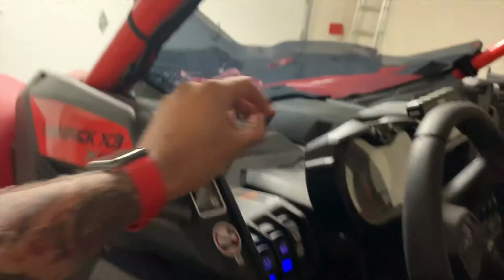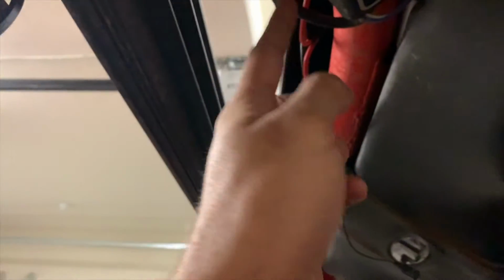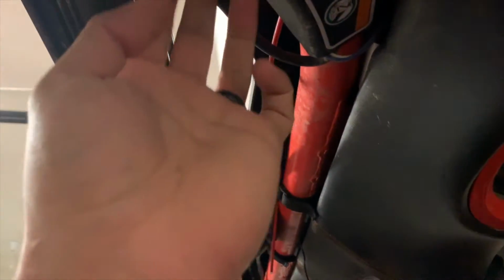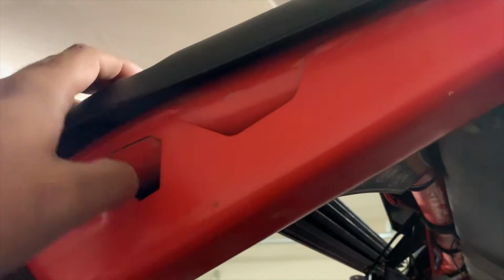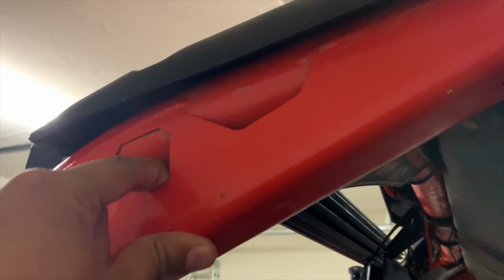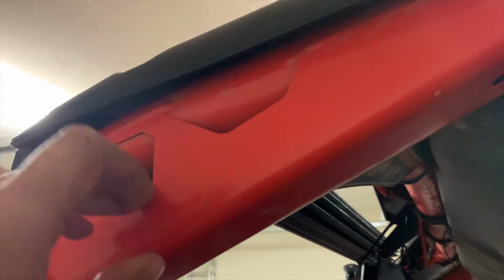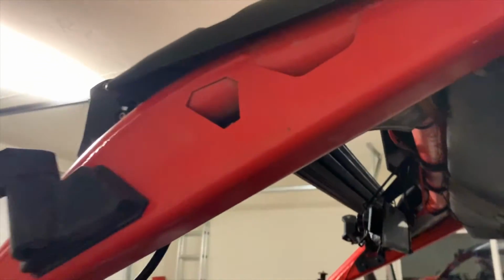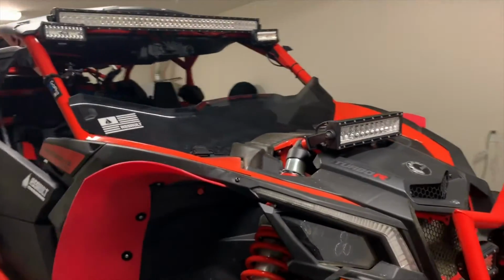This is the switches. The other end is going to be the cable for my lights, which are right up here. What I will do then is plug it in to the bar lights. I'm going to plug the black with the black, the red with the red. And then you have a third cable that is a small one. This one, I put in contact with the cage with a screwdriver. Usually you can use a screw, make sure that it's screwed in. That way it helps the contact. It makes ground, and it will help make sure that nothing goes off and everything goes well. So make sure that the ground is well plugged into the cage, and then you're good to go. Make sure you test everything before closing everything out or putting the plastics back, but that should be working fine, and that's how you should do it.